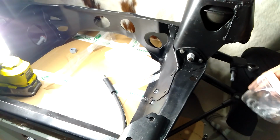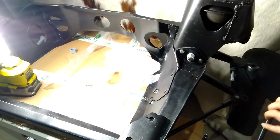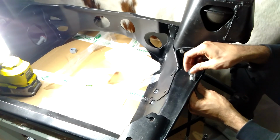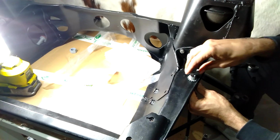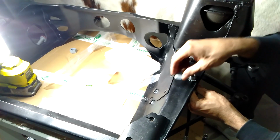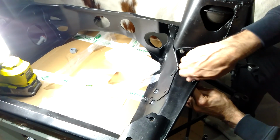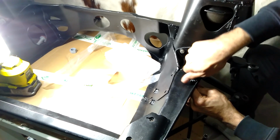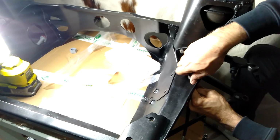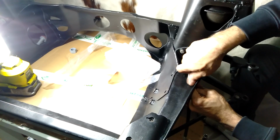All right, so then on this side again, that end of the hose will come through. There's a star shaped washer to hold everything nice and tight, and then the thin size bolt. Maybe you could use the thicker one, but it's not going to matter, I'll just try this size. So the thinner of the two washers, or the nuts, needs to go on this side, and then the brake pipe connector will just go straight into there.